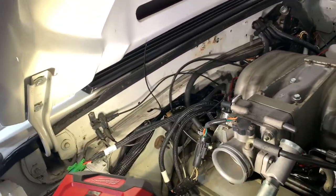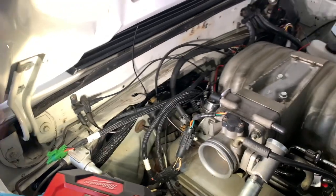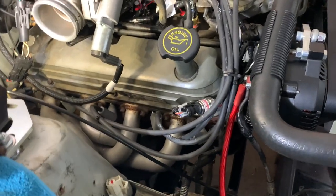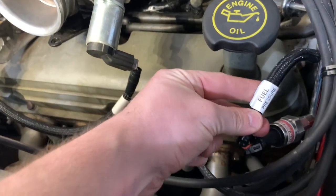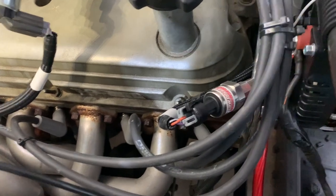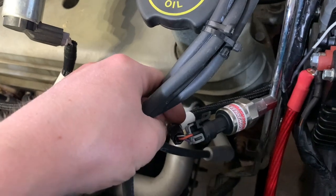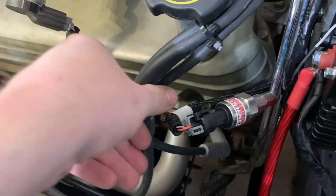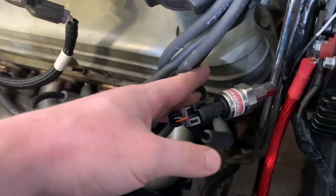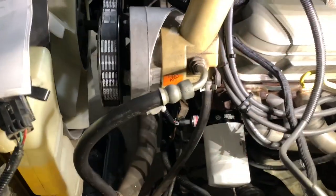I've got the intake back on the car, already done my first start, and everything's kind of bundled up — not really cleaned up because I was just going for a first start checking all the boxes. One thing I'll point out that Holley doesn't do a great job of showing you is fuel pressure and oil pressure. The harness comes with connectors for fuel and oil pressure, but Holley doesn't send you the sensors. If you want that in your data logs or on your Terminator X screen, you've got to get your own. I used a low-dollar pressure sensor for both — about $32 online. For fuel pressure, you just take out your Schrader valve, put a little 1/8-inch adapter in there, and hook up to a regular low-dollar sensor.